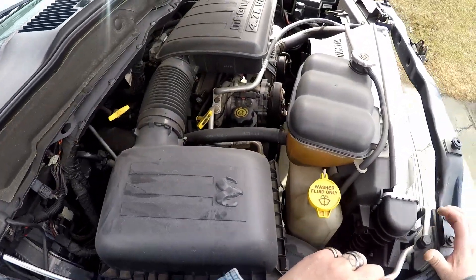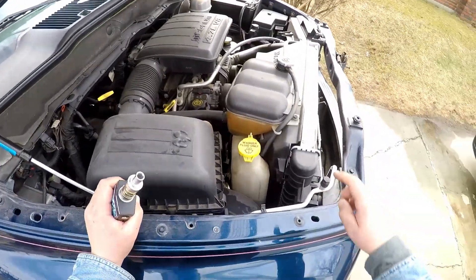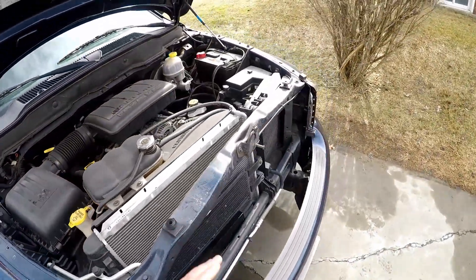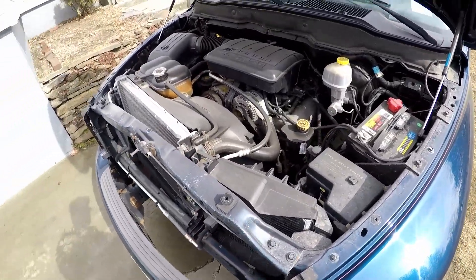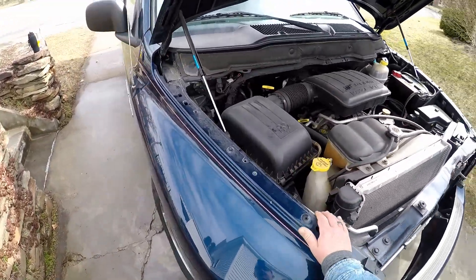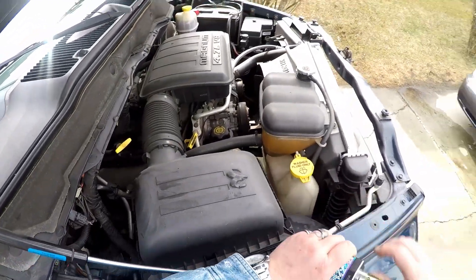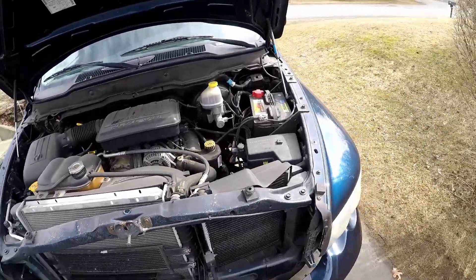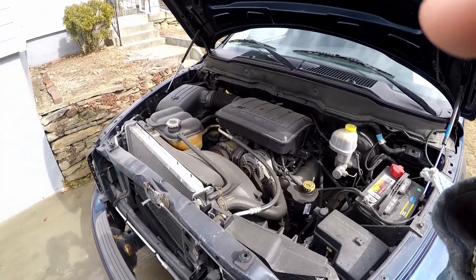You've got to make sure you get that tap water out of there. Never fill your car up with tap water or well water — the minerals will eat up some of your metals in the cooling system. I use concentrated Prestone antifreeze in all my cars. I don't use Dex-Cool in my GM vehicles, and I don't spend extra money on Mercedes coolant. I just flush them out and run Prestone with distilled water. Make sure you use distilled water — that's important to protect your cooling system.